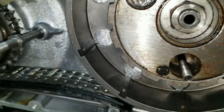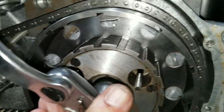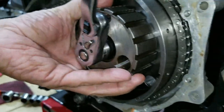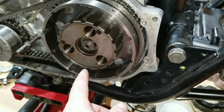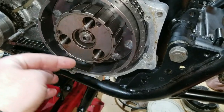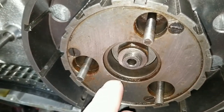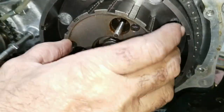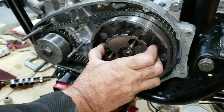Yeah. And these are all kind of tight. Yeah, they're tight. Because when we were messing with the 79 Bonneville, the dampeners that are inside here, the little rubber pieces, were all melting away and oozing out. So that's one of the telltale signs, if you see a bunch of black rubbery ooze coming out, which this didn't have. That's oil right there. All right. Well, stay tuned here.